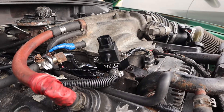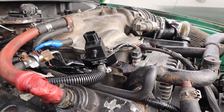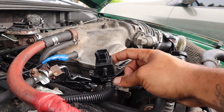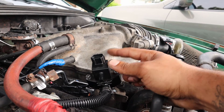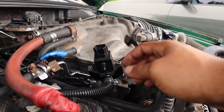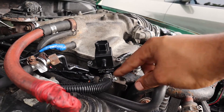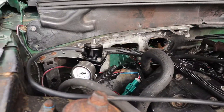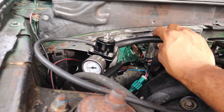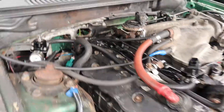What the nitrous block does is it allows nitrous to get fuel pressure. Sitting on top of it is the fuel rail pressure sensor, which has a vacuum line to it. We don't use that style anymore. The hole on the front of the nitrous block is connected to a fuel pressure regulator. Super simple — you just need this nitrous block and a fuel pressure regulator.